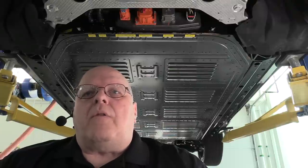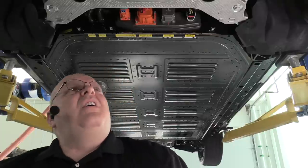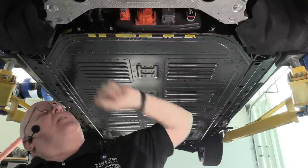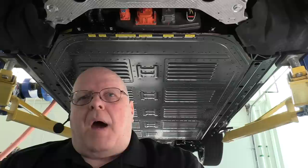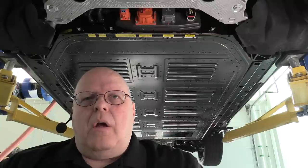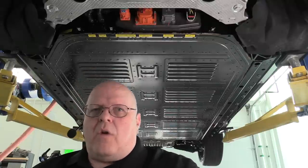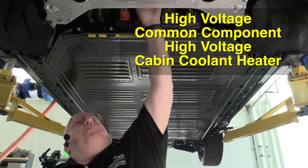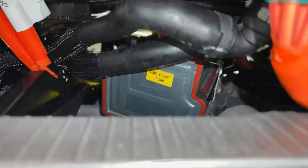While here underneath, there are also two coolant hose connections — an inlet and outlet — for keeping the battery cool or warming it as necessary. There is a coolant heater buried up inside there; it's hard to see but it is present and is another high voltage common component found on many vehicles.